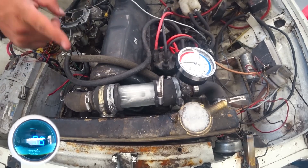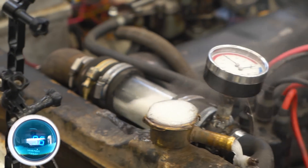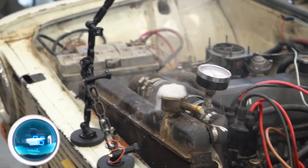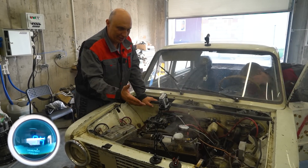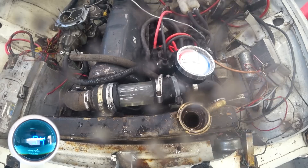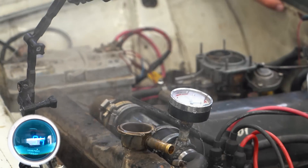Check that out — I can see a massive amount of air, which tells us that the cooling system isn't up to it. The gauge is showing us a mere 96 degrees, the engine is really hot and the liquid is boiling. Look at that fountain! Switch the engine off. But the temperature reading has dropped to 94 degrees. There's air somewhere in the system.